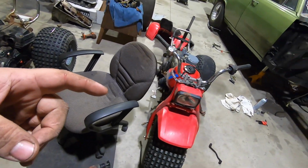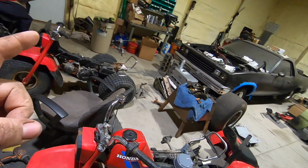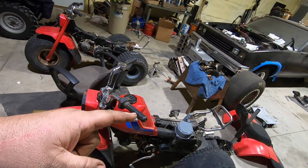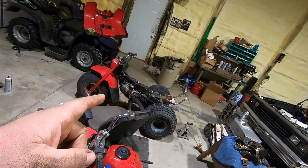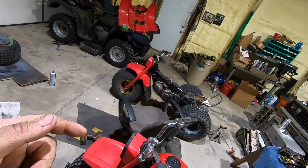And then this one I kind of bought for parts. Both of them run. That one has an insane vacuum leak where it just revs to the moon. This one, the carb was leaking a little bit. But basically I'm putting all the nice parts on that one for my girlfriend, for a pit vehicle that we can throw on the trailer.